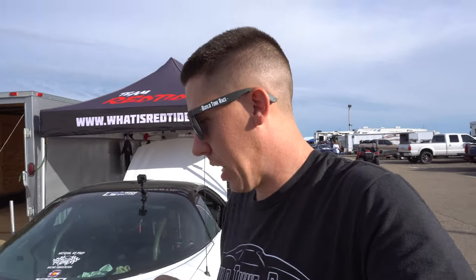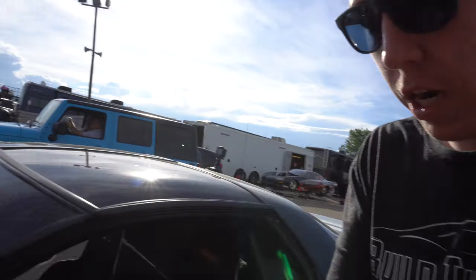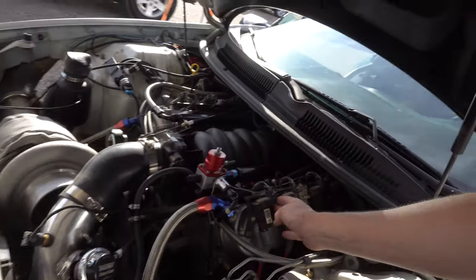Ended up making it through the cruise. Got the car weighed in — it was way heavier than it needed to be. Got everything ready, got a tune-up in it. I'm gonna go hopefully see if the 60-foot comes around. If not, I'm guessing the tranny's pretty beat up. Ended up putting new coils in — thanks to GB for bringing me those last night. I put it up on the two-step to see if it would come up any quicker — didn't seem to. So I'm just thinking the car's not pushing through the power, it's just slipping through in first gear. Boost looks good, everything's there that it should be, but it's just slow — especially in the 60-foot — and that's what makes me think it's slipping.